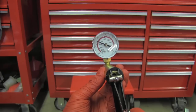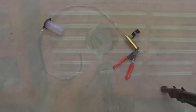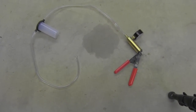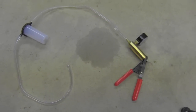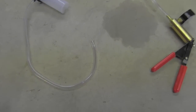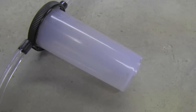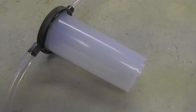Let's put it all together and do the brake job. Here you can see the tool set up for the brake job. Basically what you are doing is applying vacuum — this is connected to the brake caliper and it sucks the old brake fluid into this container. When you are about two-thirds full, you stop, get rid of the old fluid, and continue the job.